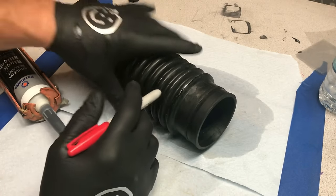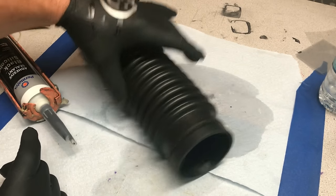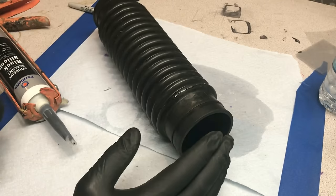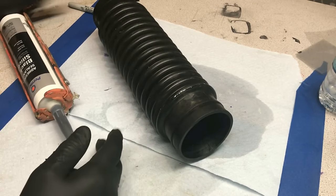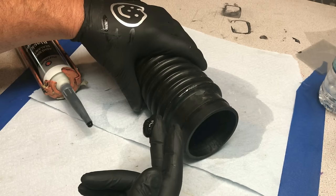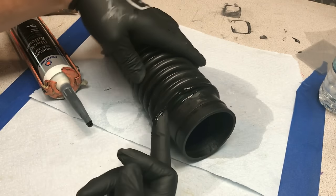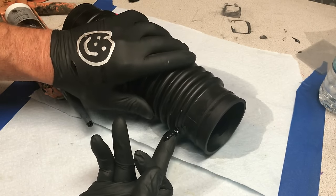Now, if the crack is inside the rib, it makes it a little bit easier. If you put this on an intake — off your air intake box or wherever it may be on your vehicle — we try to refrain from putting anything inside, just to make sure nothing goes into the engine. So now we're going to use Permatex black silicone, which is pretty much the only thing we use around here. I just go over this like that, put a nice heavy coat on it — I like to have about an eighth of an inch thick on top.